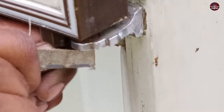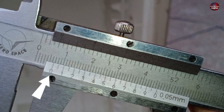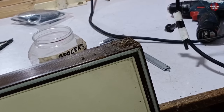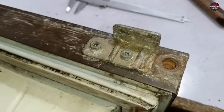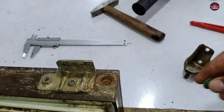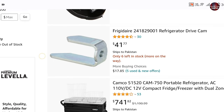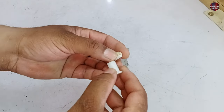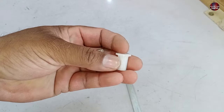I will remove all that rust from the pin using sandpaper. The rust is removed now. The radius of the pin is 7mm. Now I am drilling a 7mm hole inside so I can install a new cam of the same size. The cam on the lower bottom side of the refrigerator is also worn out. I have an old cam that I am going to install for the door's lower side. You can order a new one from any online store according to your required refrigerator model. I will make a new one for the upper side of the door.